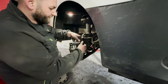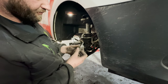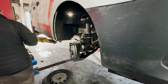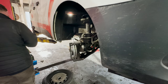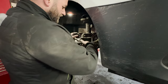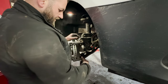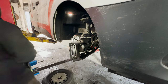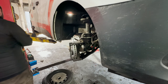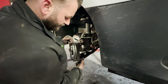We're just going to pop these sliders out — just pull them out. You can see that one's actually clean. We'll just put some fresh grease on that and pop it back in. Everyone has a different opinion on what grease to use, so I'll let you decide. I do use copper grease or lithium grease. Fair amount of grease on it — pop it back in, make sure the rubber seeps back down.